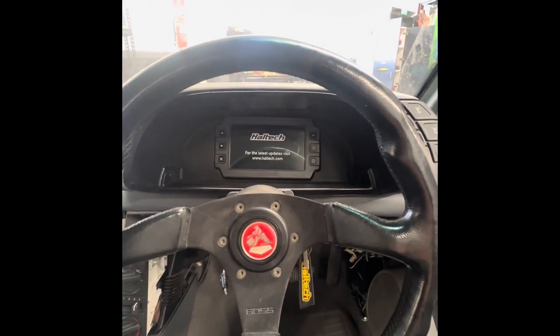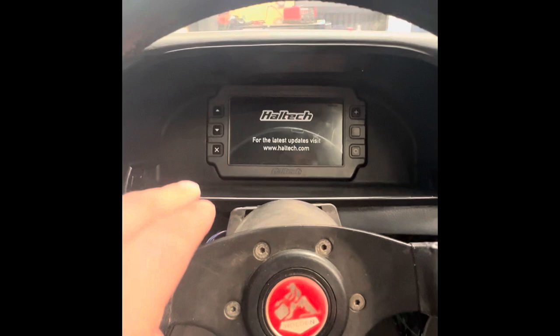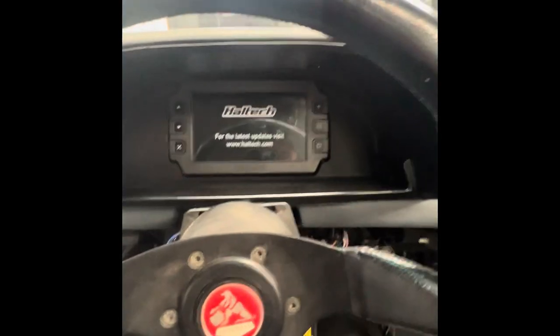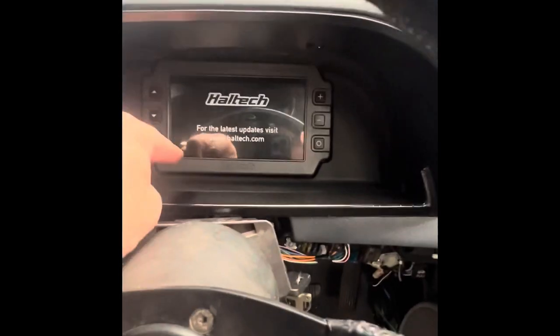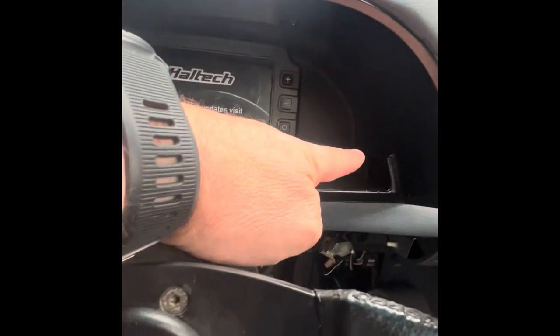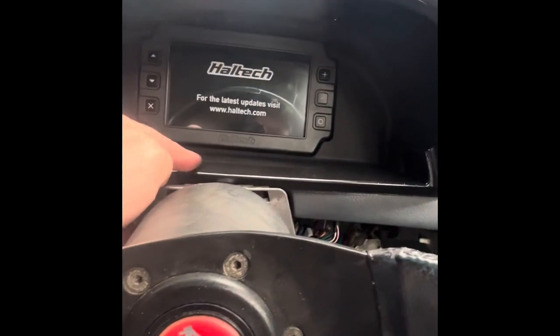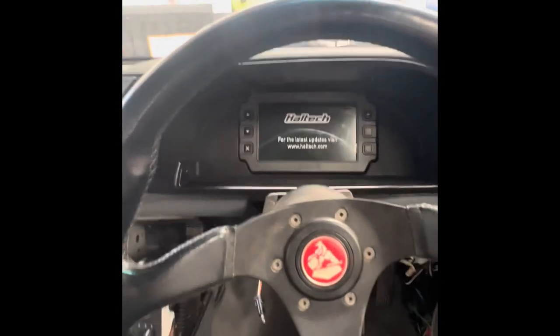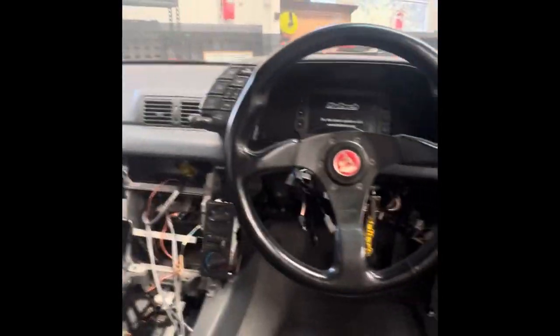That's the IC7, and it's installed. You'll notice I've cut out the bottom row that you'd know from the VS Commodores, because that gets in the way of the bottom row of data on the Haltech. I did some pretty good work there, I reckon, because I had to cut out the center upright section that supported the cross bar coming from the left and right sides. The holes that were left, I filled with plastic epoxy, then primed and sprayed it, and installed it with the Mako dash surround in the back. At the bottom, that's the connection that's going to go to the ECU, and this is a connection I'll put in the dash so I can plug a data cable for a laptop in there, get live data, track some things and make changes if I need to. So the dash is installed.